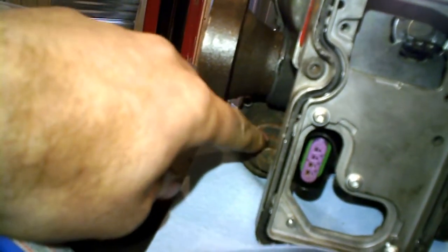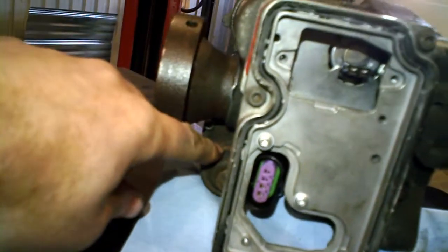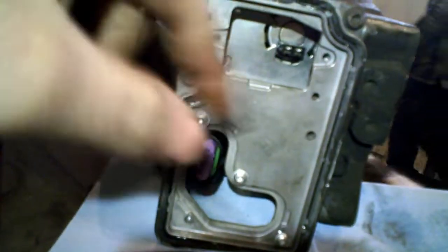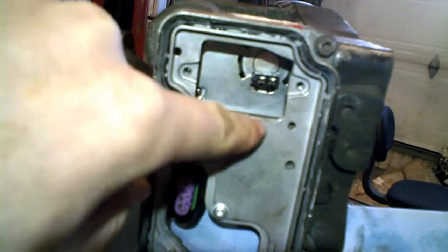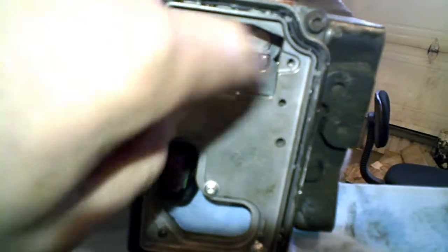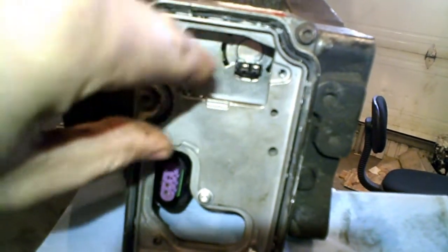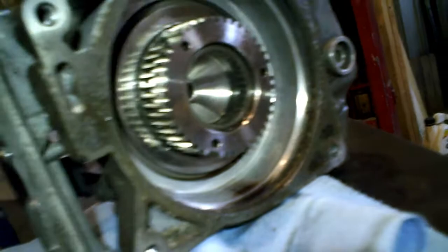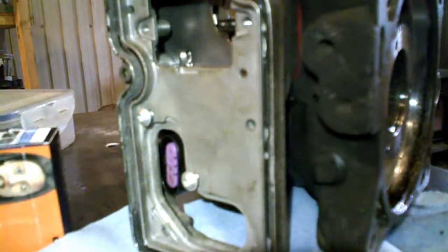How it's working, first of all, is that you have a hydraulic pump here that creates the hydraulic pressure, and at idle it just flows freely in the system. But when the ECU, I mean the control unit of the clutch pack, is applying current to this solenoid, it just adjusts the hydraulic pressure that goes in there and makes this piston push on the clutch pack. So it's pretty simple. It's cool, but it can have flaws.